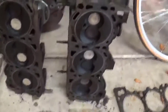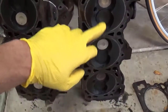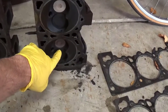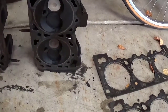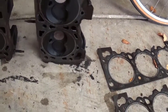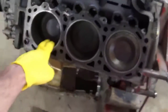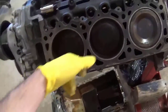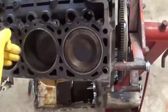Because on the heads, if you look at them, you compare every exhaust valve, what the color they are. Notice how this one's darker. This head has a crack in between the valves. This was the driver's side head on number 4 cylinder. That's the front one, which would be this one here. This piston doesn't look like it had it. Doesn't look that bad. This side's okay.